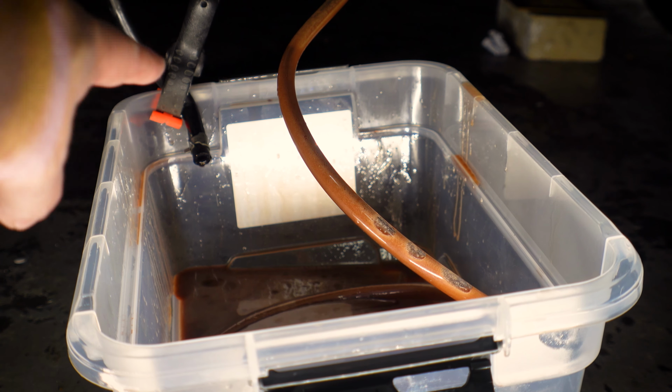It made things really easy, and I just plumbed it in line with the intake, and then off we went. The good news is that the pump speed for the external pump flowed at a reasonably similar rate to the trans when it was running. So I think there was only about 1 or 2 points in this that I had to switch the car off and let that external pump catch up, so that I didn't let the fluid levels get too low while we were doing the flushing process. Overall, it was messy but uneventful.